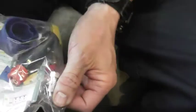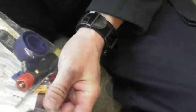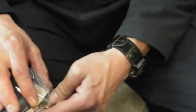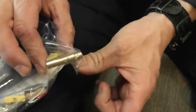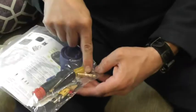Now when you talk about draining the system down — what we need to know is what you do. Down here is your drain down unit. The drain down is that yellow lever there — that drains down your boiler and the tap system. Hot and cold water comes out of that hole there and underneath the van. So that yellow clip — it's just a pipe going out down through the floor onto the ground outside. The position it's in at the moment is closed — it's flat, it's closed, that's allowing water to run around the system and out through your taps.